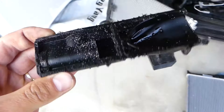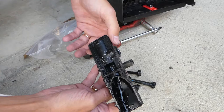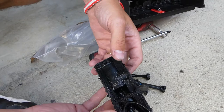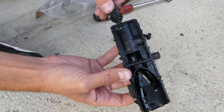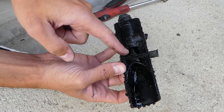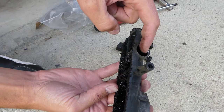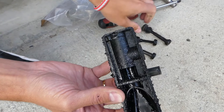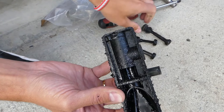You can see this is the outlet for the automatic transmission right here. This is the bottom piece of the radiator where the automatic transmission cooler hose connects. If you have the long one installed — check it out — it goes all the way down, but it allows water to go around the pipe and come out, so the coolant flows through. That's why you need the long one for automatic transmission. But if you have manual and install the long one, you'll leak coolant. With the short one installed, it simply stops and plugs the hole right there. That's how simple it is.